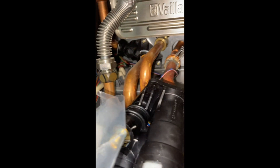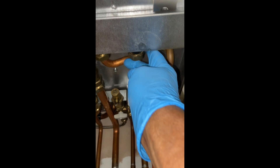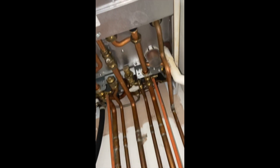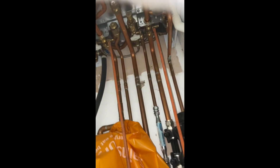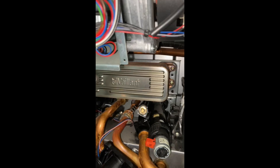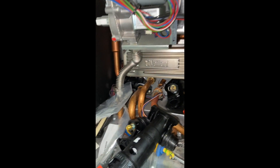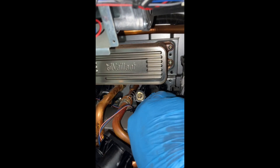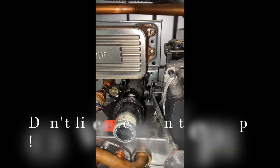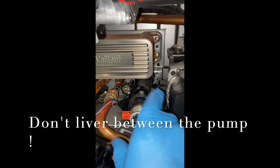This pipe was going like that. I have to remove the compression fitting here. There was a compression fitting and a holding nut there, so I have to remove that. Then pull this one out and take the old diverter out. Just shake it a little bit. Don't lever it — it might damage the pump base. So just take it easy when you take it out.